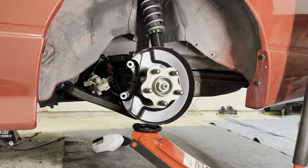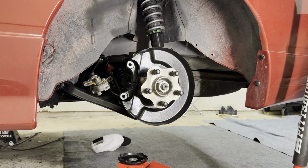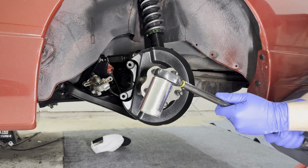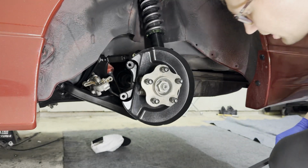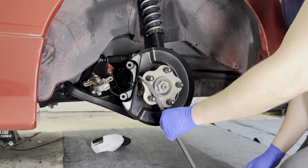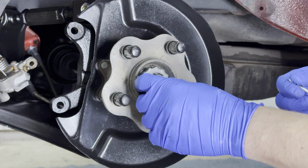Next up, we need to torque the axle nut between 152 and 215 foot-pounds of torque. My torque wrench is just right on the border there. We're gonna pretty much max it out. Check it out, we're gonna have an issue, right? Can't really torque this whenever this thing is moving. So we're gonna borrow a hand from Mr. Crowley here to jam it. And put this cap on now with the fresh cotter pin.